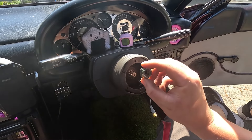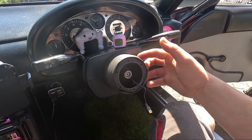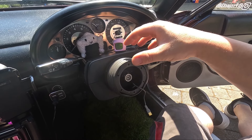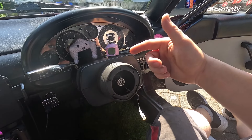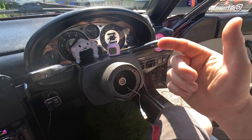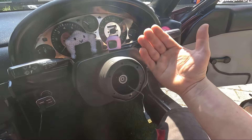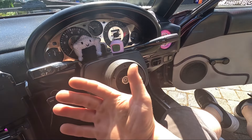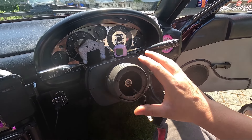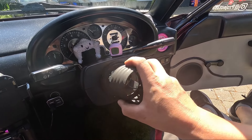Put the nut back on just a few threads, because when you remove your steering wheel or adapter it's going to save the horn and airbag wires behind it — they do tend to break if you pull it off too hard. Sometimes it's really stiff. If you've still got a steering wheel attached you can hit it from behind using both hands. Try to do it evenly so you don't bend anything — it will eventually come off.